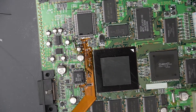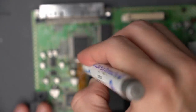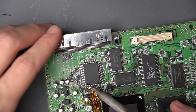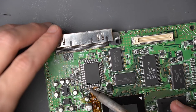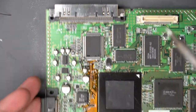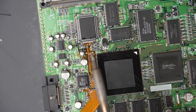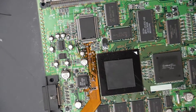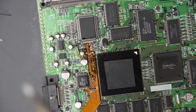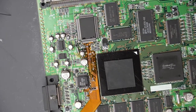Okay, I think that's everything. Definitely going to start back on this audio chip down here, put a bunch more flux here — that's going to be the key. I have a huge bridge on this side, so before adding new solder I'm just going to clean that up. My strategy for cleaning these up is the same technique I did with the Super Nintendo — I'm not going side to side, I'm going to go just into the pins and then back up. That way, if I've got extra solder, I'm pulling it out rather than spreading it around. And I'm also not going to break any of those pins on this IC.